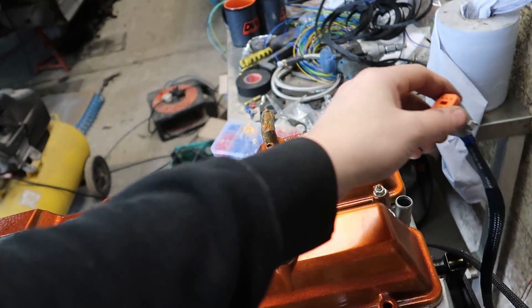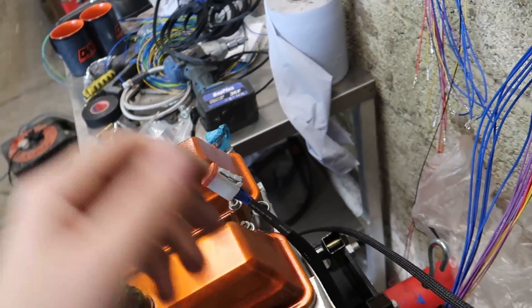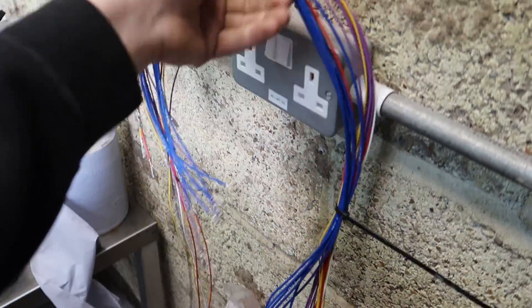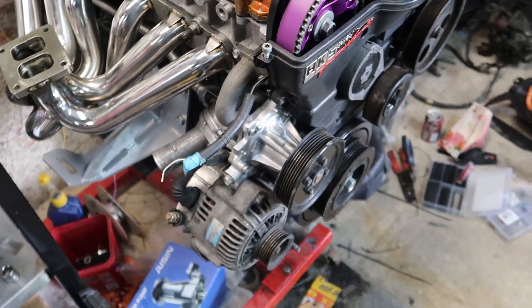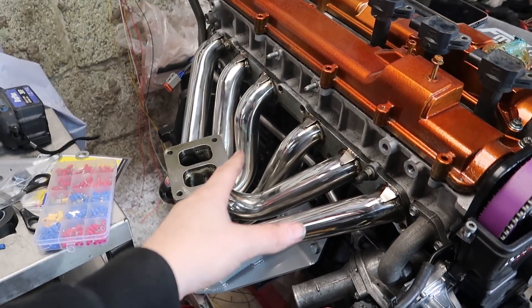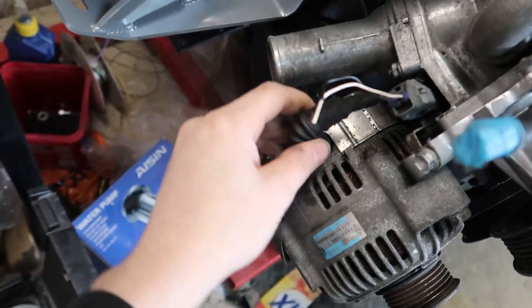The alternator wiring won't go to the ECU - that goes to the car's fuse box. On the injectors I've put a six-pin Deutsch connector. I haven't done the coil harness yet because I'm not sure which coils to run. I was going to use K24 coils but they sit a bit high, so I've ordered some shorter coils to try. They'll have their own plug so you can disconnect them separately, making life a lot easier.